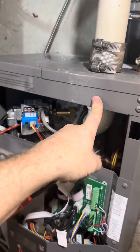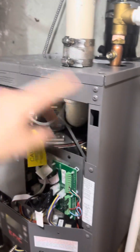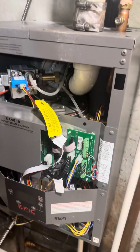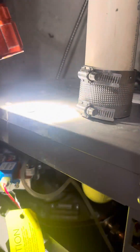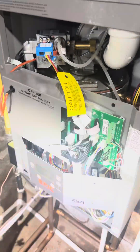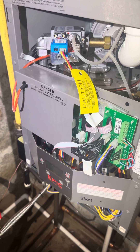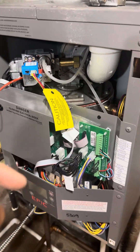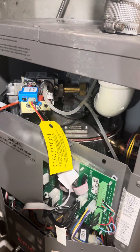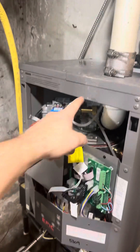This bar up here — I find it's easy to remove once you've got this all apart to get the heat exchanger out, because you're going to disconnect that nut and the one down in there, and then the whole heat exchanger lifts up and out. There are two bolts at the back that you'll need to reach once the lid is off that hold the heat exchanger in place — roughly two half-inch or seven-sixteenths nuts. Disconnect them, pull them out, and the heat exchanger then lifts up, turn it a little bit and it comes right out with the bar removed.